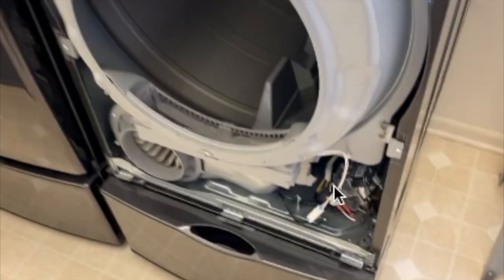In the bottom right-hand corner of your dryer, after removing that panel, you can see your coil pack, your igniter, etc. Your actual thermistor is behind this fan ducting here. In the event you can reach in and gain access to the electrical connection point and the Phillips screw that secures the thermistor, your project may be a little easier. However, if you cannot gain access, we're going to continue taking everything apart.